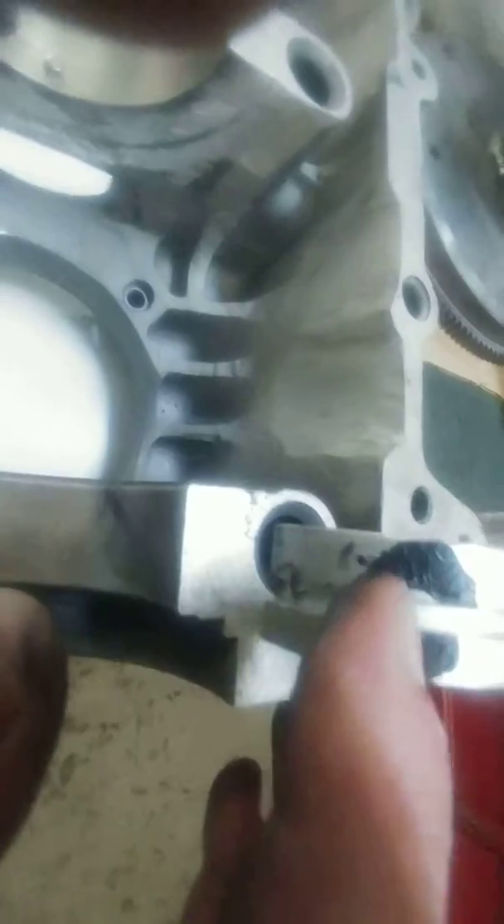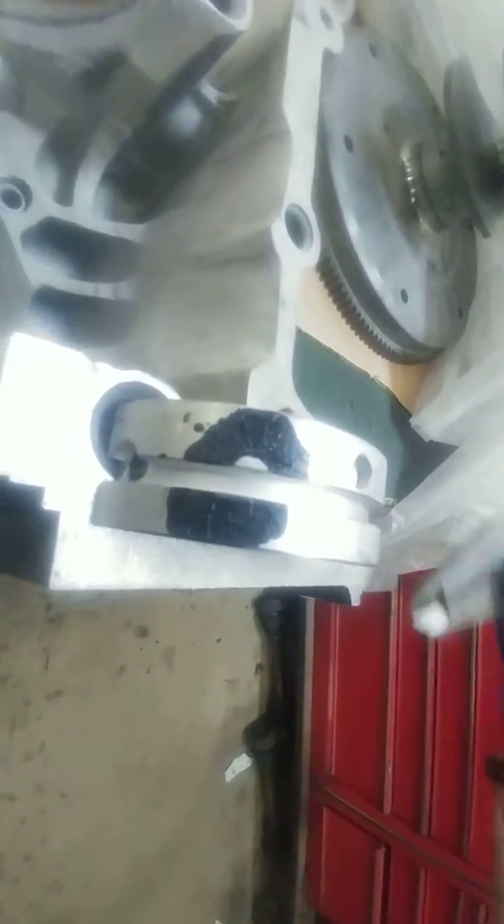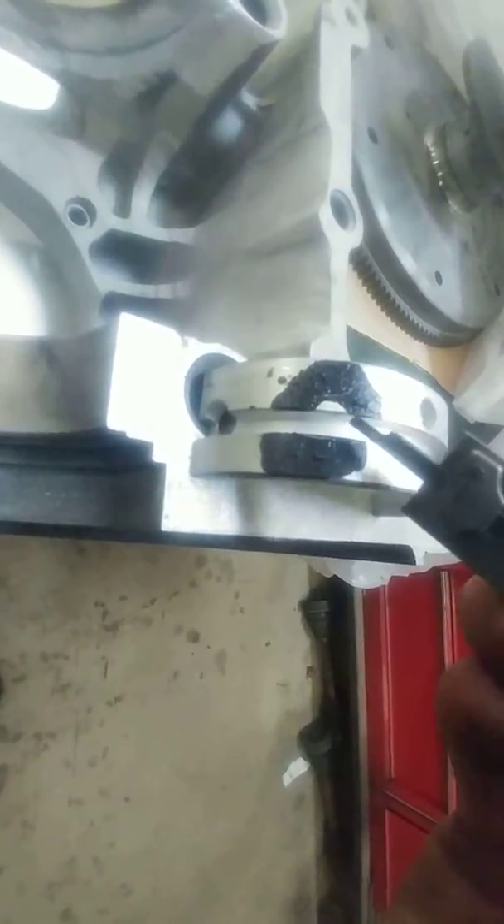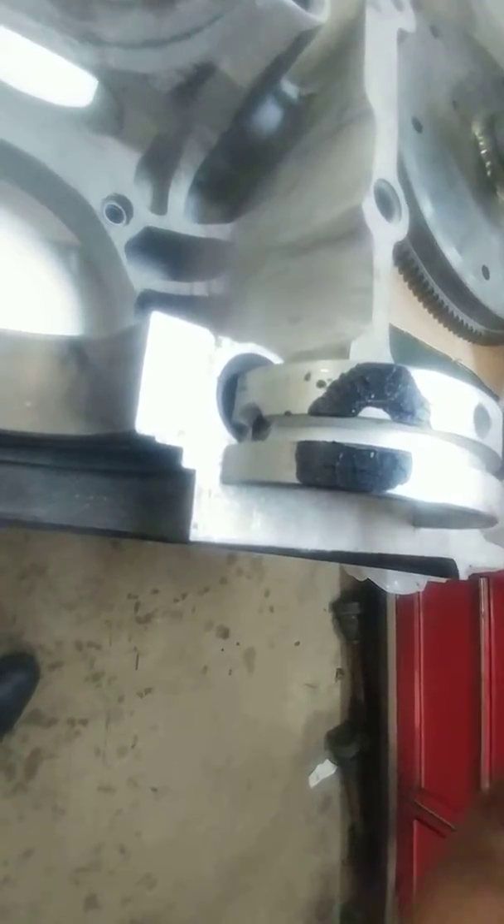I'm going to have to carve this out, open that up, and radius it. Let me take my vernier and run a depth mic setting to see what I have. It looks like I've got about 112 and a half thou - call it 113 thou, the vernier just clicked to 113. So I've got 113 thou deep. I think I'm going to cut this radius open and bring it down to a depth of 100 thou, because I want to make sure I don't go too deep in this groove and compromise the integrity of the bearing or cause a catastrophic failure in the bottom end.